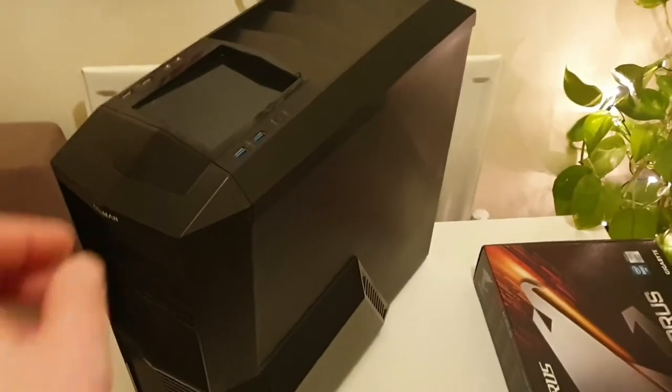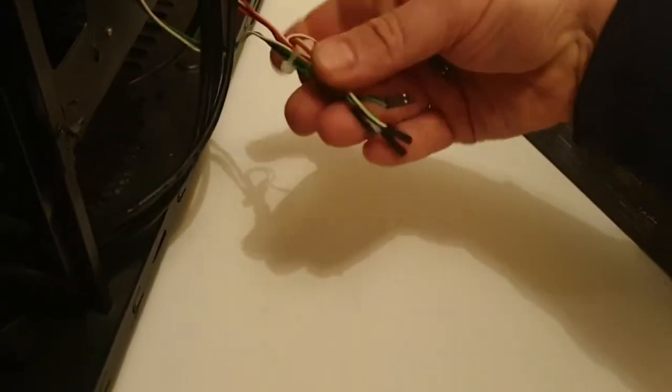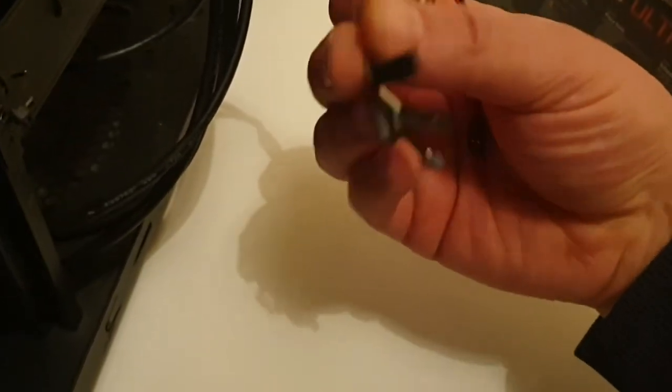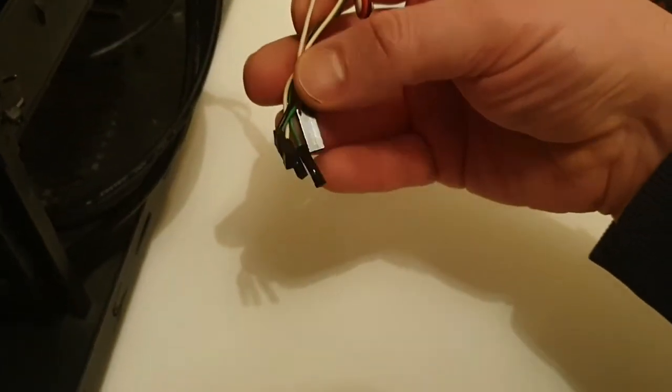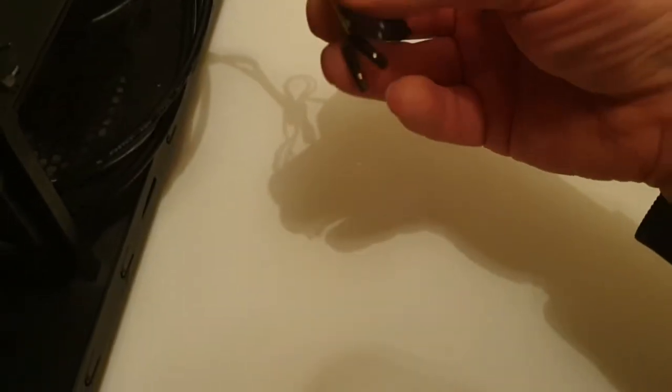If after this your computer still doesn't turn on, then we need to open the back panel and look for the cables that are connected to the motherboard. Once you open that panel, you will find a bunch of wires. We will need exactly the power SW and reset SW.